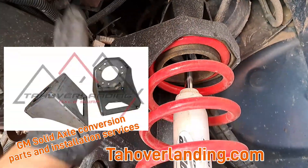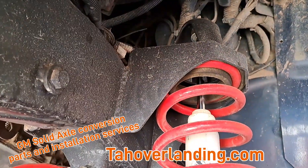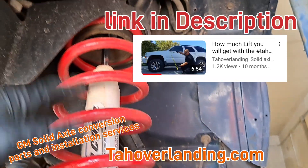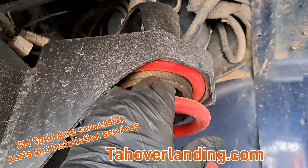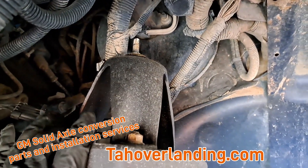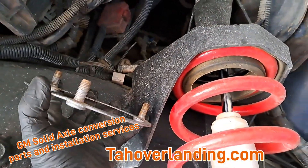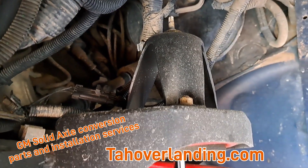That there is the Tahoe Overlanding coil spring mounts. Those are adjustable in height and designed to have the correct coil spring spacing for GMT frames. If you use Dodge Ram 1500 springs you can adjust the height, or if you need a lift spring for even more height, those are compatible too — using the Dodge Ram rubber coil isolator up top. It also uses a Dodge Ram factory shock mount with a ring and bolts that hold that shock mount on. It gets sandwiched from underneath between the rubber isolator, and those are the studs that hold the upper shock mount on.